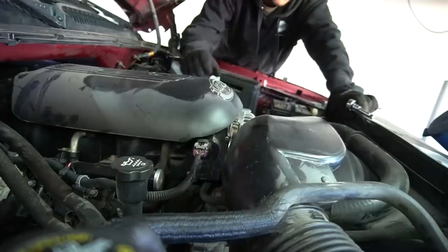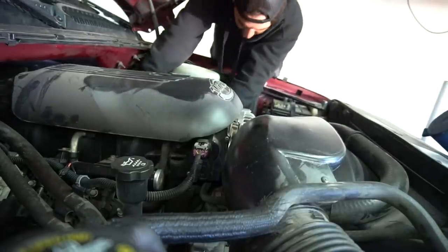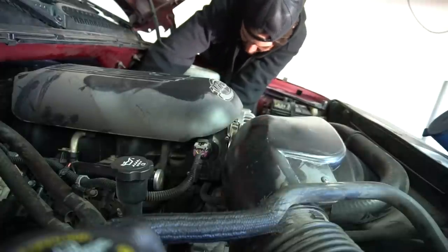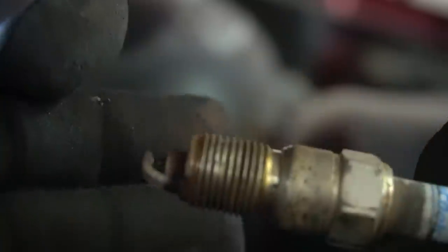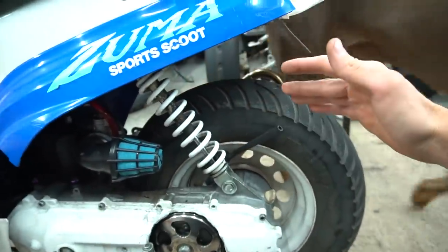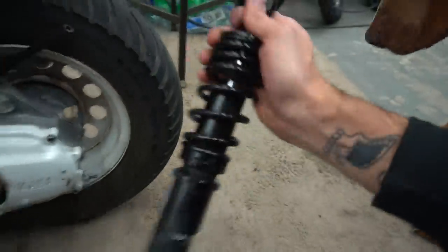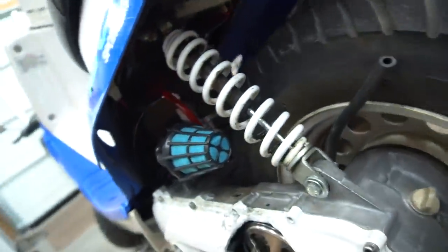So I'm gonna finish this up. Every plug is seized — I feel like these plugs have never, ever been changed. It's because they're so seized with rust and years of corrosion. You got this nasty crud in the thread. This bike is really bouncy — I just hung it up otherwise I'd show you guys. This stock shock makes this thing so bouncy that it's actually scary to wheelie it. So I got this NCY shock, which is the same one I have in this bike and I really like it. I'm gonna throw it in here.